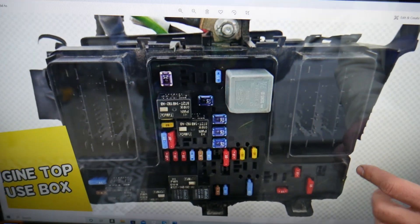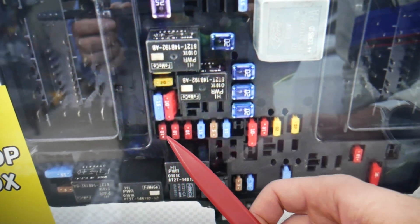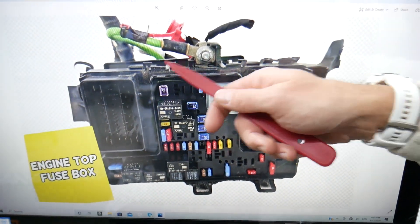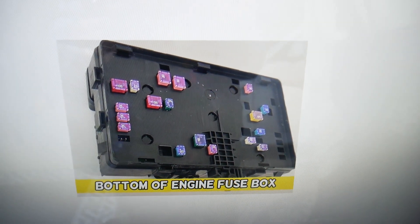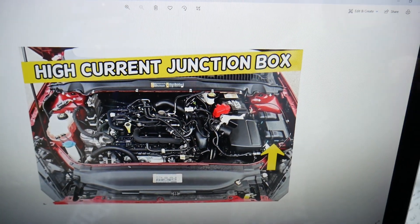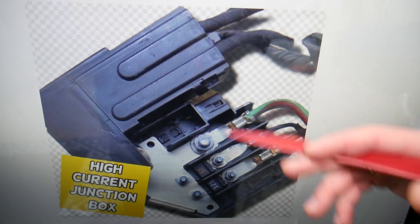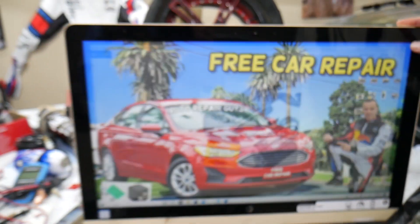Here we need to check one fuse, then go find one hidden fuse. In this row, start counting — fuse 18, 19 — fuse number 19 is the one we need to check. This fuse box has a couple of tabs; when you release them and flip the fuse box, you have hidden fuses underneath — but none of those are the ones we need. Grab the whole fuse box and lift it up. On the bottom you have a high current junction box with mega fuses, and the one we need to check is mega fuse number 8 — a 70-amp fuse located under this cover right here.